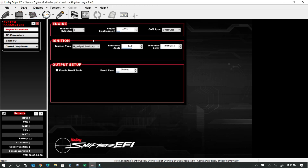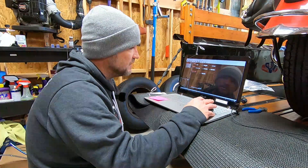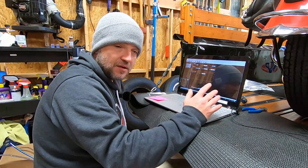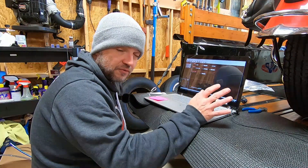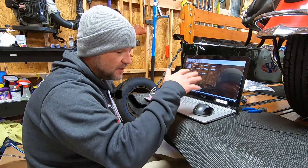Moving into parameters: I've got it set at 427 cubic inches because I want it to give me a little more duty cycle on the injector — it changes the map globally. I'm running 8 cylinders. You never want to make more than one change at a time when diagnosing a hard start problem. I will not change that displacement number until the car starts cold perfectly every time. When it does, I know if I bump that number up, I'll need to reduce the cranking fuel linearly.